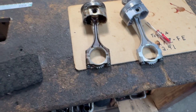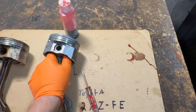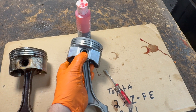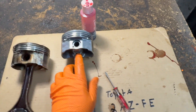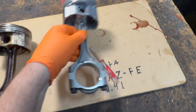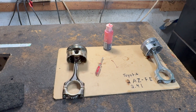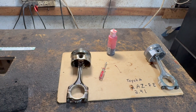And there you go — no trip to the machine shop for this one. A lot of cars are like that. Some are pressed in, where there is no C-clip; basically they heat up the rod with a torch, slide the pin in, and center it up before it cools, giving you the same effect. But if you're not familiar with that, you'd have to bring it to a machine shop and they could charge you like 15 bucks a piece. Fortunately, if you've got a 2AZFE engine, you can skip that step. Motor Car Nut — please subscribe, hit that like button, any questions leave them below, I answer all my questions. See you guys in the next video, thank you very much for watching.